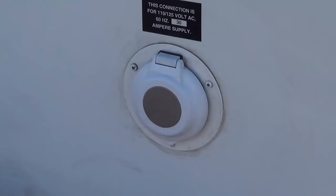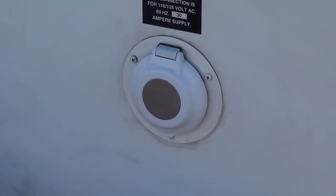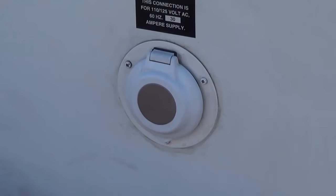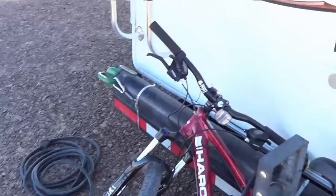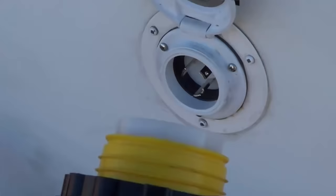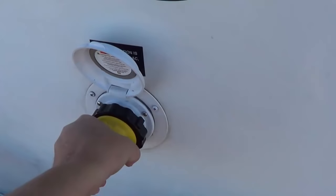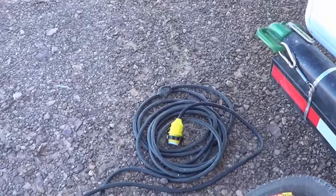Upgrade number sixteen is replacing the old shore power cord mouse hole with a proper disconnectable receptacle. Before I had to jam in and pull out 30 feet of cord every time, and it was hard to handle in cold weather. I bought a conversion kit from Marinco that gives me a disconnectable receptacle — an end goes on the cord, twists on, and gives a nice waterproof connection. When leaving the campground I just disconnect, wind up the cord, and stow it in one of my storage bays. Easy as pie.